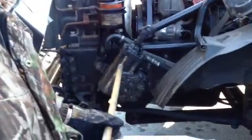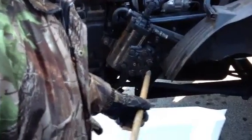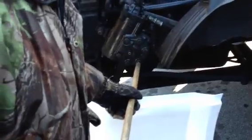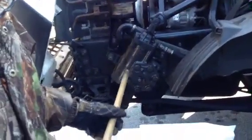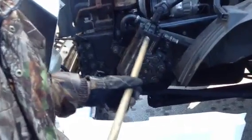I'm going to check my gearbox. Check my gearbox, make sure it's properly mounted and secured. It's not loose, it's not bent, it's not broken, no illegal welds on it. I'm going to check all my bolts on it. Make sure none of my bolts are loose. Make sure they're all intact, none of them missing. There's no sign of looseness on them. The sign of looseness would be shiny threads or a rust trail. And make sure they're all tight. Okay? Then I also want to make sure that all my seals are not leaking around my bolts. Okay?